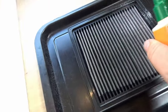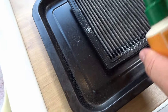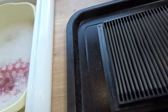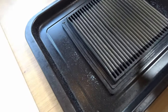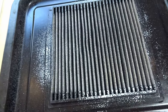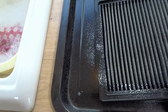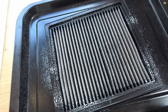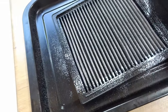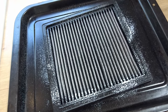So we're going to use some oil - a bit of WD-40 spray does the job. And then we're literally just going to spray it over it, I'll flip it over on both sides. Top tip: if you do it over a baking tray, any oil that misses the air filter gets on the baking tray ready for putting some sausages on for your dinner. Then we let that sit for about 10 minutes or so, let it kind of sink in, and then we can put it back in the car.